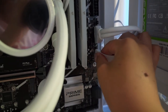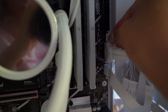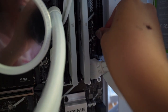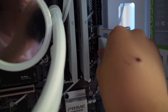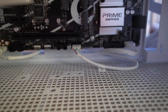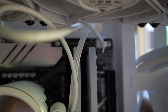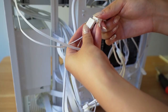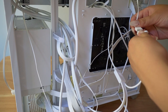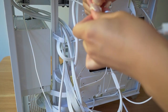Now I'm connecting the front panel USB connectors to the motherboard. I love that the cables for this case are white to match the aesthetic. The case also comes with a fan on the back, so I'm connecting that to a fan connector as well. Here's the layout for all the other connectors: audio, USB for the AIO, front panel power, and all the other cables connected earlier. Each AIO fan also has an RGB cable and a fan cable — the three-pin RGB connectors go into the RGB splitters and the fan connectors into the fan splitter.